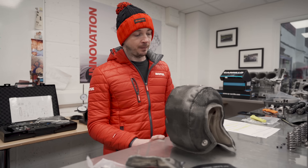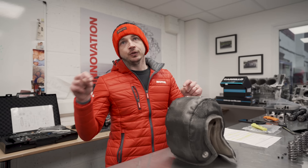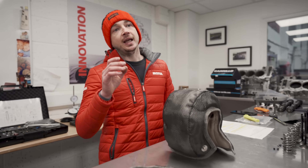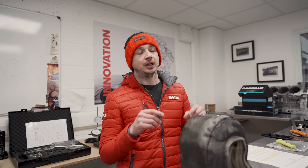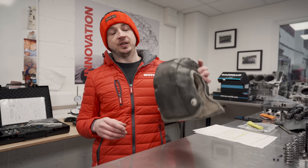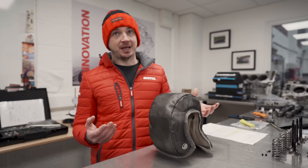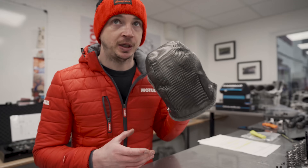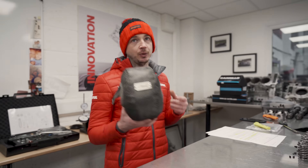There might be instances where you can't use a fabric, but nine times out of ten you go for this. Some of the biggest McLaren stuff we do with downpipes is lagged with Funk blankets. You can get that thermometric heat shield stuff too - they tack weld it on like the stock cars - but it's still a conductive material. On R8 and Lamborghini headers wrapped in that stuff, you do a massive pull and you'll still melt your hand - there are still hundreds of degrees. It might give you a barrier to take out a hundred or two, whereas these are rated to five to six hundred degrees temperature reduction from inside to outside. That's massive. 120 quid versus four or five hundred for ceramic coating, and not as good performance.